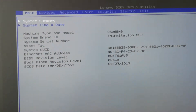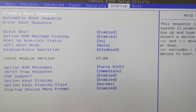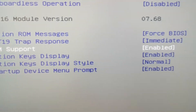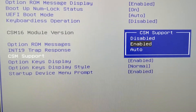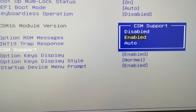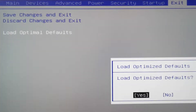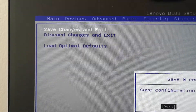I've powered it up, gone into the BIOS, and I'm going to load the setup defaults. Here in the startup menu — quick boot, CSM support — that's the one. CSM support is set to enabled, and if I change it to disabled and reboot it seems to corrupt the BIOS and the machine never works again. Same problem if I set it to Auto. So I'm going to leave it set to enabled. With a fresh BIOS, I'm going to load optimal defaults, press Enter, yes, then save the changes and exit.